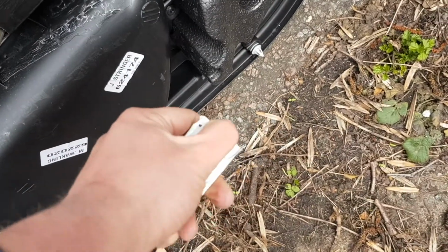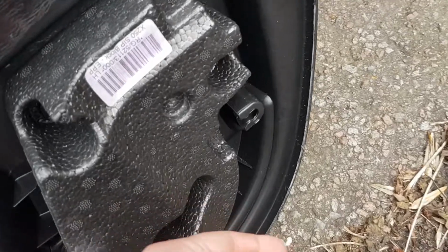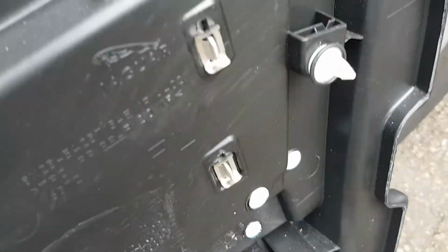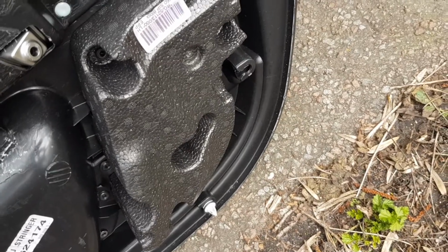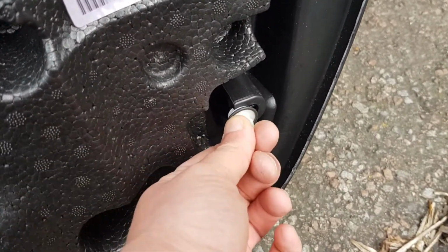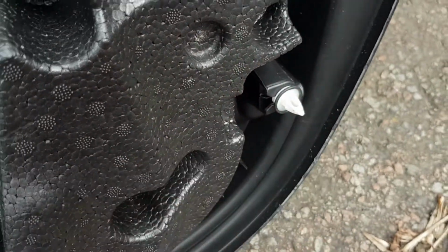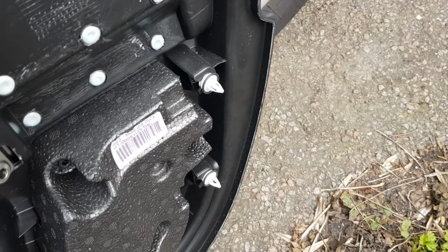And then what we do is we go back to the door card, we remove it from the tool like that, and we find the slot where it's come from. Fortunately on this Jaguar all the clips are exactly the same, so you can mix and match. Doesn't matter, they don't have to go in the exact same place that they came out of. You just slide it in like that, feel it, and now it's ready to go back on the door once we've finished the work that we're doing.